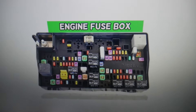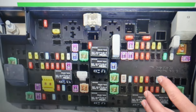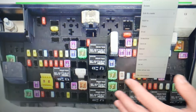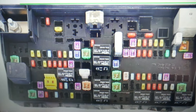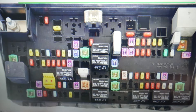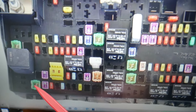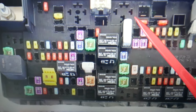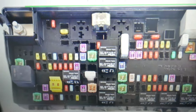Here's what you will need to check: a few fuses need to be checked for the central locking system. The first fuse you need to check is fuse number 14, right here. That circuit breaker fuse, which is CB1, will need to be checked as well. Please make sure to stay to the end — we want to give you one good piece of advice so you don't end up stuck in the middle of nowhere.